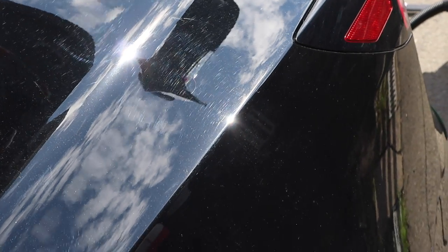Just as I come to wrap up this video, I want to offer a little bit of advice. If you're ever considering using a hand car wash, find one that you want to use and maybe just go and sit outside it for five minutes — see how they wash a car, see if it looks safe. If it does, the next thing to think about is how busy are they? Are you going when there's maybe between five and ten cars waiting? Because if you do, you could end up with pre-wash on your car for quite a while, as sometimes they walk up and down pre-washing cars. And lastly, what time of day is it — is the sun shining? Because if the sun's shining, that's going to dry out any pre-wash or acid-base wheel cleaners they put on your car, which could inflict damage. If you're able to avoid all these things, then by all means, if you're willing to take the chance, go to a hand car wash.